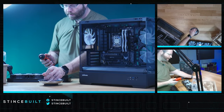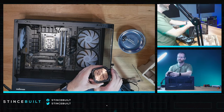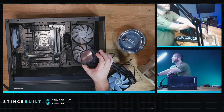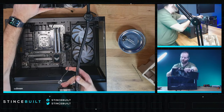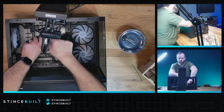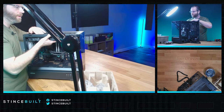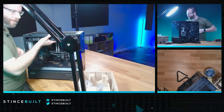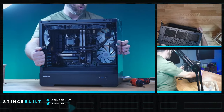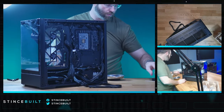Let's get our fans secured — all in. Remember to always take the pump cover off the AIO head — one of the sponsored streamers we even helped with their PC from another company didn't take it off. Take it off. The 360 AIO mounts in here effortlessly — holy cow. I was expecting it to be a little harder, maybe needing to angle it in, but it goes right up and in. Cable management back here, including a lot of RGB daisy chaining, wasn't terrible.